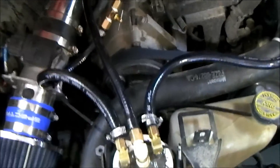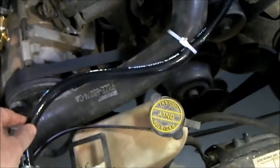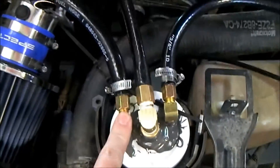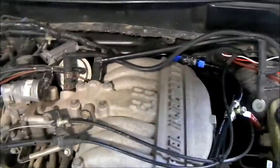So we've got your fuel vaporizer going. This line here is coming out going back to the intake. We're teed into the fuel line that goes to the fuel rail, and that's dumping fuel in — you're regulating it with the needle valve there. Then you've got this one going back to the intake manifold, and this one goes back to the crankcase right after the PCV. So you've got a breather filter there to keep crankcase crap out.